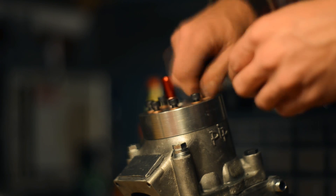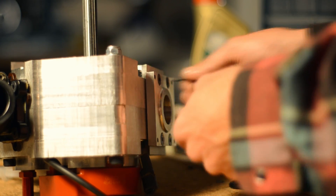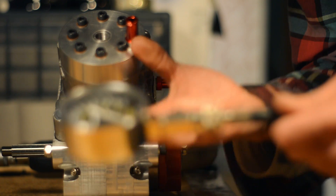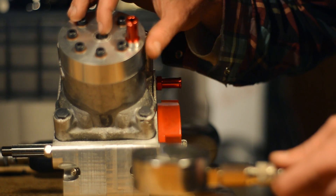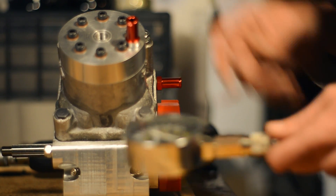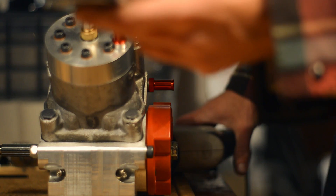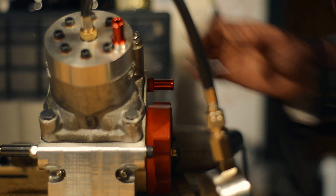We'll do a test again with a proper ring gap. This gauge is just some cheap crap, and with this long hose it's not accurate at all, but relative measurements are okayish. I know that on this gauge, good 50cc engines with comparable combustion chamber volume and exhaust height, I see about 100 psi — that's what we're shooting for. Previously I'd seen about 50 psi in this cylinder with that previous ring. Now that's about 75 psi, which is much better than before. We'll have to try to start it.